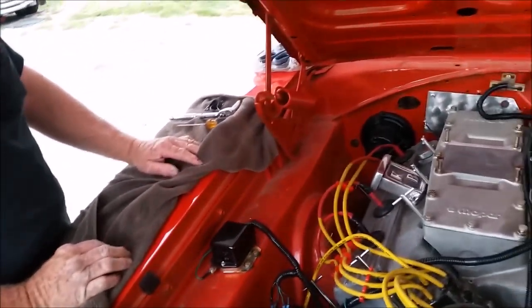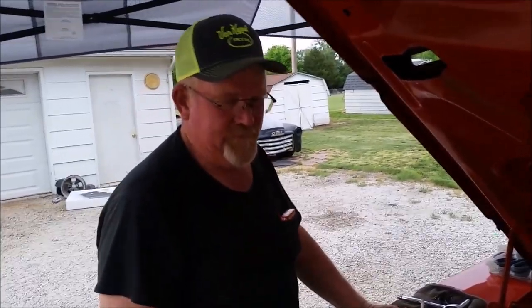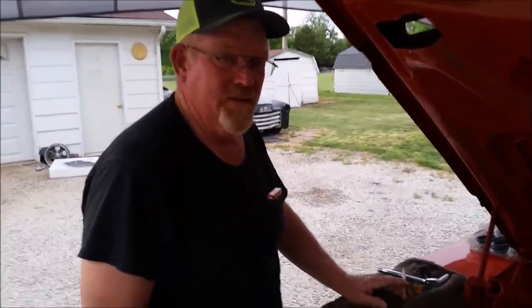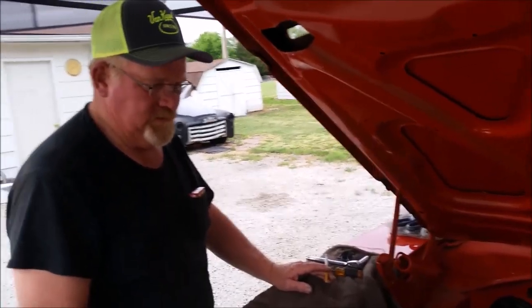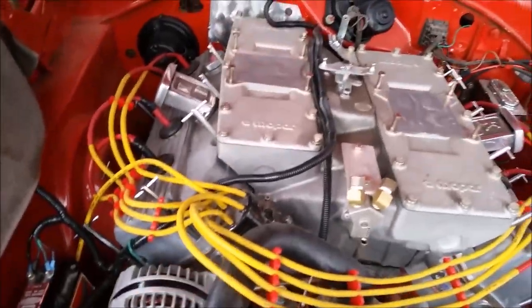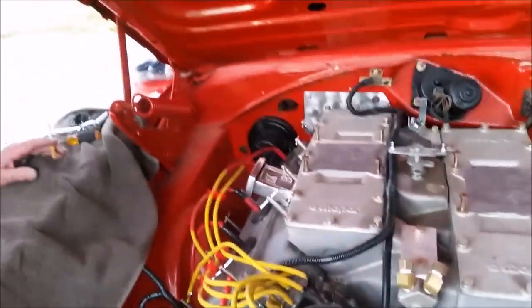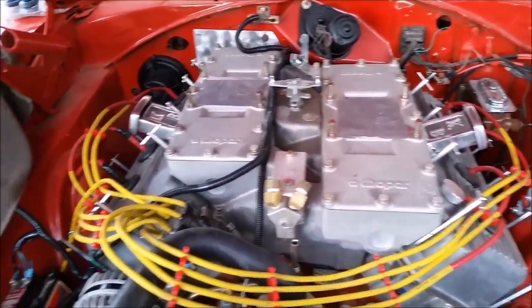And we do not run electronic ignition. Why do we not run it, Dad? We had way too much bad luck with it. Yep. My Satellite had a factory electronic ignition, and I've never had luck with it. I use those electronic distributors for yard darts. Throw them. But we run aftermarket dual points. Every car we got has dual points. Fire up, never had to really fuss with the points. Ever. We've run it for years that way.